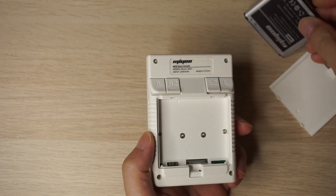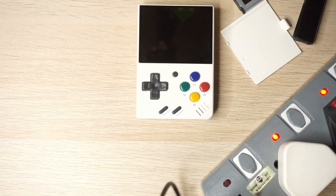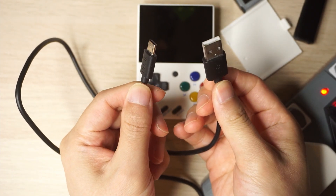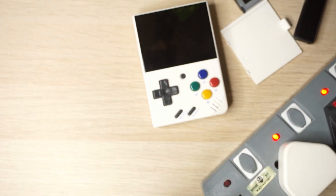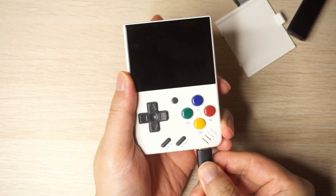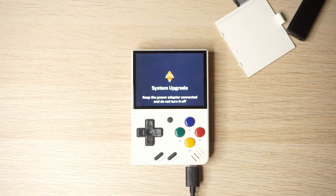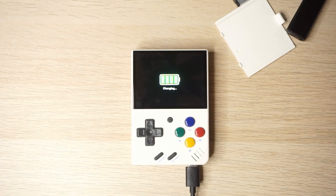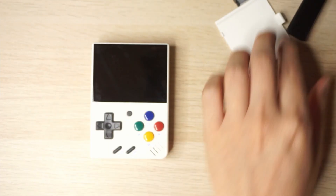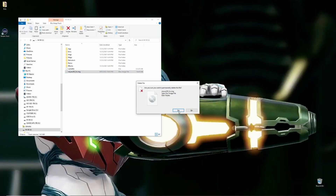Next, take out the battery, then insert the micro SD card back in. To activate the firmware installation, you need to charge the handheld — make sure you use a 5V wall charger and a USB-A to USB-C cable. Don't charge from a PC as it's not enough power. Once you plug it in it will start installing and it doesn't take long, maybe about 3 or 4 minutes. Once you see the green battery charging screen you can unplug the cable. Put the battery back, take out the micro SD card, delete the firmware image from the card, and then reboot the system.